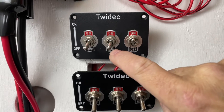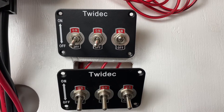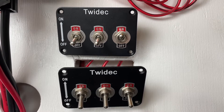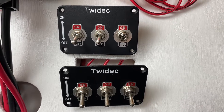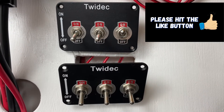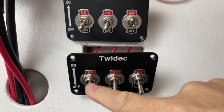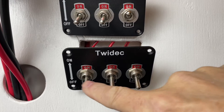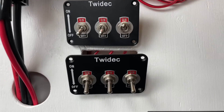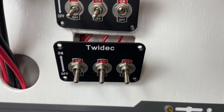This is a set of light switches, and I'm also going to double the lights in here. I have four of those 12-volt LED bulbs — I did a video showing how I made that light string — and I'm going to make another complete string of four, so I'll be running eight lights. I'll put the heater over here on this switch, and then I'll have three open circuits left off that six-position board that I can add more things to.